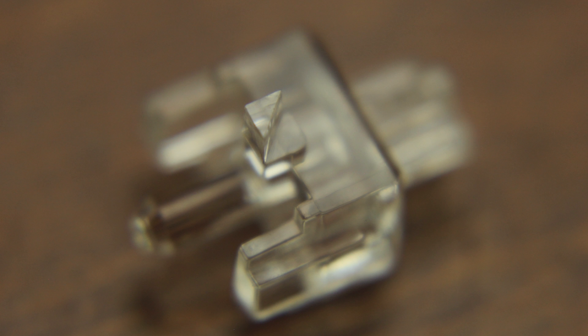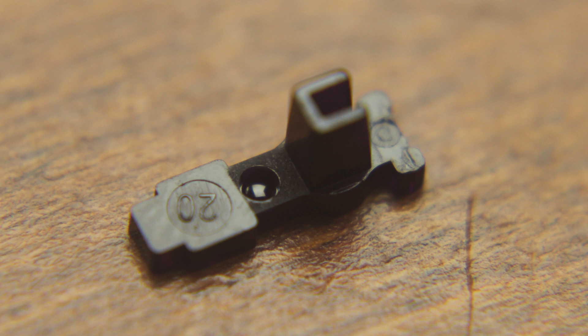Next up, it encounters this prism, which is actually part of the slider. Uniquely, the slider is made out of a completely clear and colorless material — I suspect some polycarbonate or the like — which is necessary as the prism is optically active. The diagonal part of the prism reflects the sideways beam downwards again. Then finally, the downward-directed beam is focused again by another lens embedded in the same plastic part that also contains the other lens and the reflector. After this lens, the photoresistor below it reacts to the amount of light that gets reflected onto it.